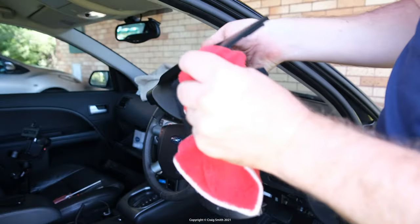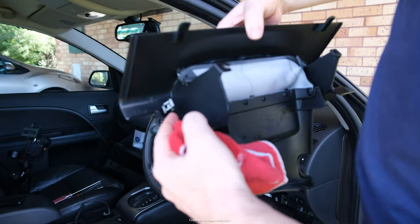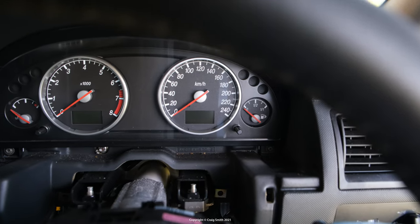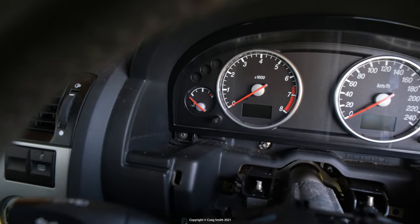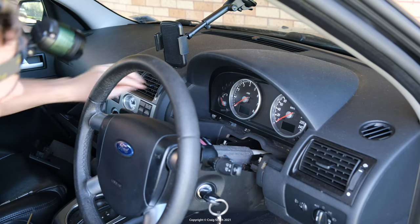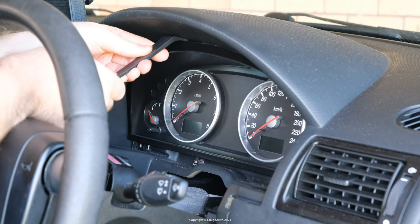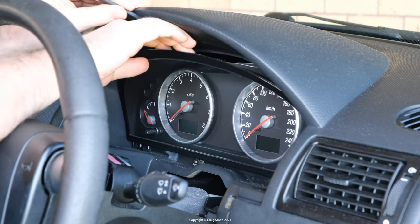Here is that piece out of the car — I just wiped everything down as I took it out, as it's a good opportunity to do so. And here at the reverse side you can see those clips. Finally, the cluster itself is accessible. It's held in place with only two further screws, very easy to undo — same posi heads, just at the bottom two corners. Once they're both removed, the cluster will be loose and can just be backed out. To start it moving, you probably want to get a trim tool up in the top centre, just poke it in the gap and lever it a bit forward.